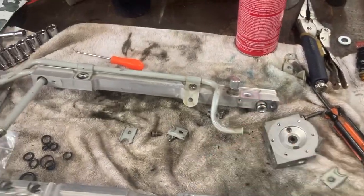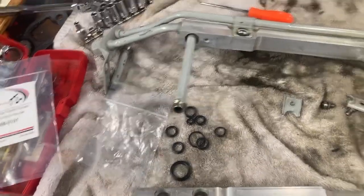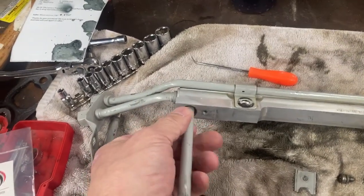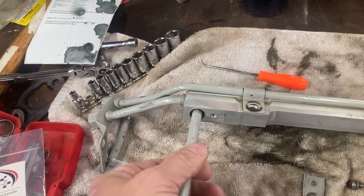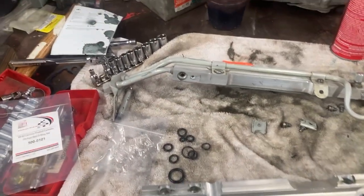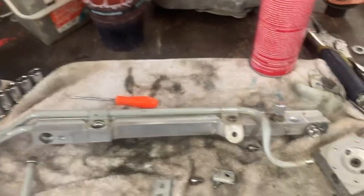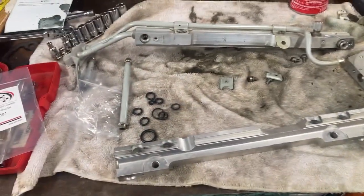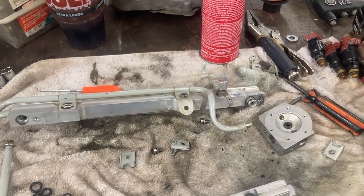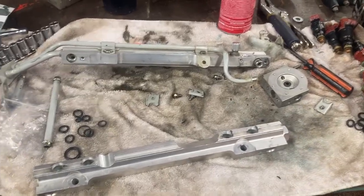These things have quite a few o-rings in them, and the o-rings around the corners like here will start leaking — especially with ethanol fuel use, or if the car has been sitting for a while. If you did a motor project on your TPI car or let it sit a long time, you may find these things start spraying fuel. Mine was taken apart for a while, so I just wanted to be safe and do it now.